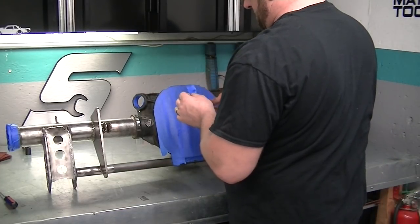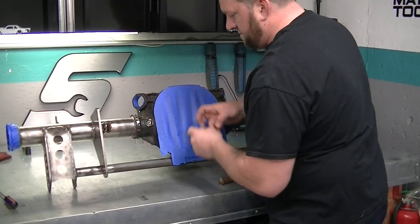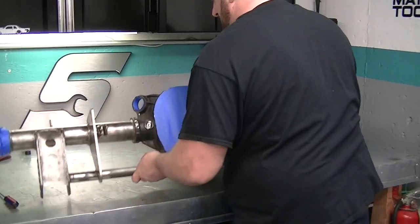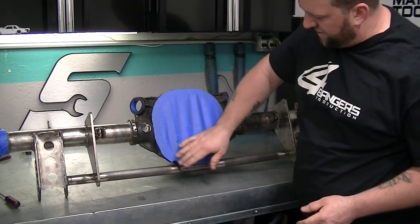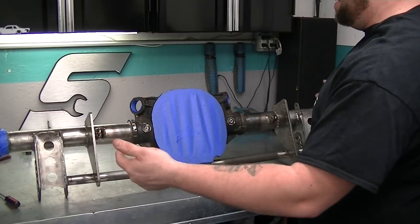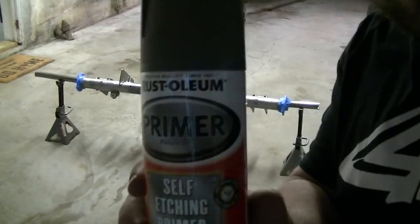It might work with other metals but I use brass just because it's the safest since it's non-marring. There you go - perfect paint edge, no issues, all the way around. Perfect and beautiful, and it was a lot faster and a lot easier. Now what I'm going to do is I've got two pieces of pipe, we're gonna stick them in the ends of this thing, tape around that, sit it on jackstands, and then we'll start putting up some of AutoZone's finest self-etching primer.